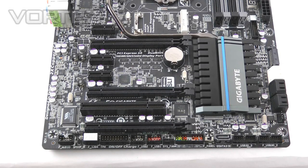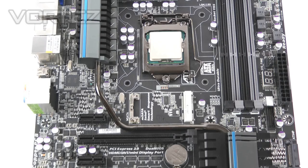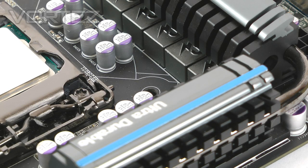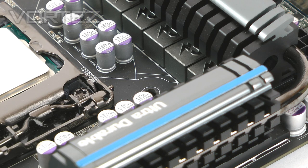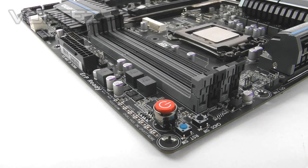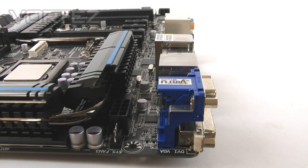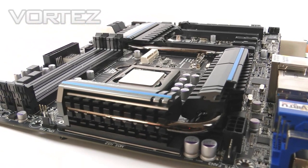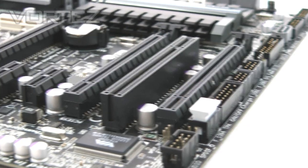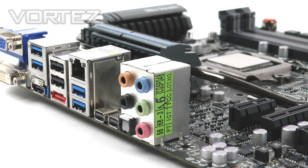So we've reached the end of the video. Visually the board is absolutely stunning — if we were judging on visual appearance alone the UP5 would win hands down. In terms of performance you're looking at very similar numbers to the UD5 and other rivals. It overclocks really well with Ivy Bridge — I dropped in a 3570K and that overclocked up to 4.7 GHz without any hassle. The feature set really does excel: mini SATA, additional USB 3 headers, UltraDurable 5 components, the included Wi-Fi and Bluetooth card, and those dual Thunderbolt ports making it future-proof for Z77.